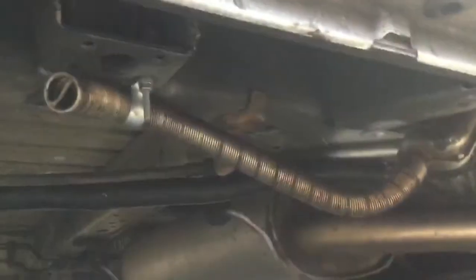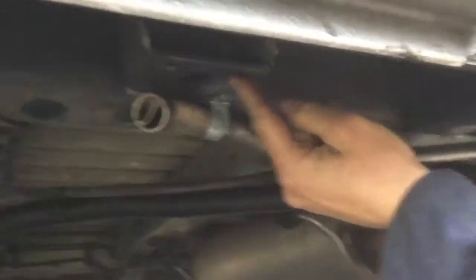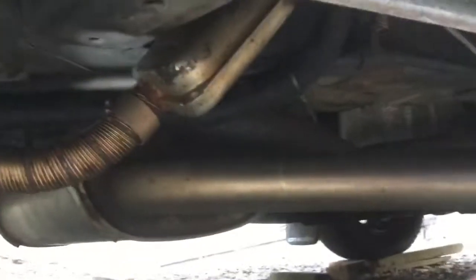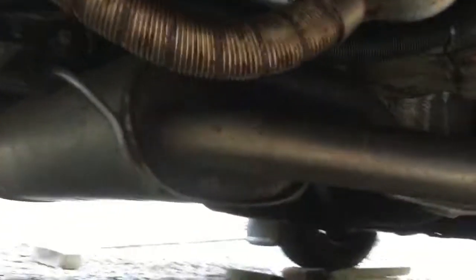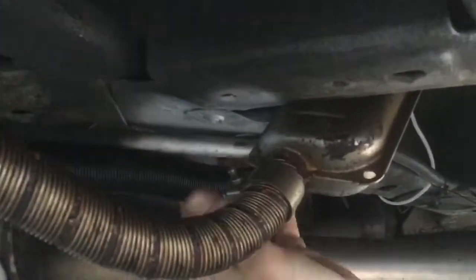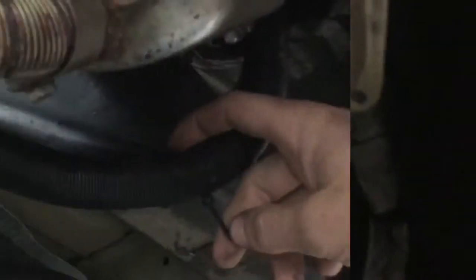Using the magic of speeding things up, I've got that done. You can see we've got the exhaust mounted just here to an existing hole in the van, just with a bolt and a bracket I had available — you could just use a piece of bent sheet metal for that. I've also got the exhaust silencer mounted; I had to modify the bracket slightly by putting it in a vice and bending it. Don't be afraid to modify the brackets if you need them to sit in a certain place — they're just literally a piece of sheet metal. As for the intake, I've just cable-tied it to my handbrake, which is totally fine as long as it's out of the way.